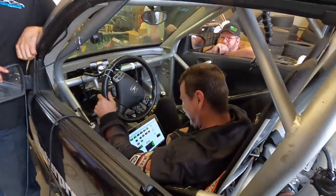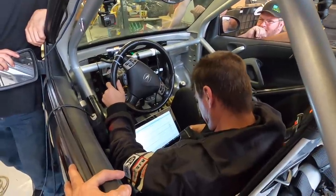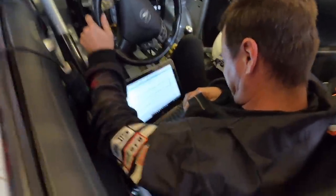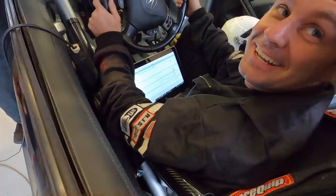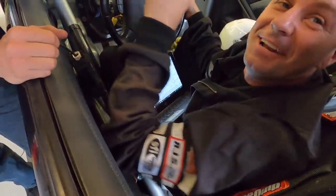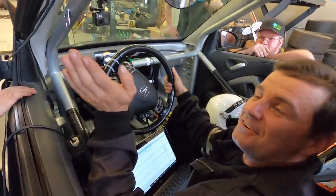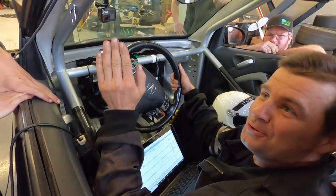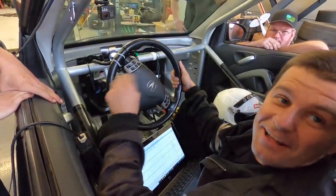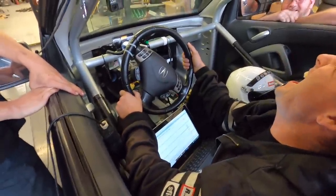Oh my gosh, dude. That's going to be drag radial time immediately. What kind of boost did I get, guys? 19.6. Oh my gosh, dude. That's moving it up 300 RPM. Yeah, went from 7,900 to the rev limiter at 82, and it went up another 3 pounds of boost. Or 2.5. We probably shouldn't do that.